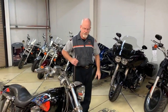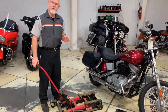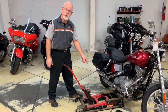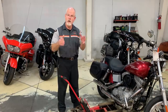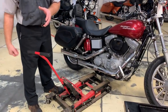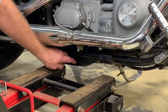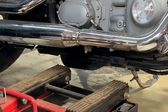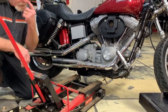Another style lift that has become quite popular — a lot of companies sell this style. It slides underneath the motorcycle, but as you can see, this one stopped. A couple of things it does not work with: first, a lot of Harley-Davidsons are lowered and it won't reach underneath due to its starting height. Second, the Sportster has an exhaust system that sits lower. On this Dyna, the factory protective plate makes it so the lift slides under barely and it's cocked — it's not a level surface.